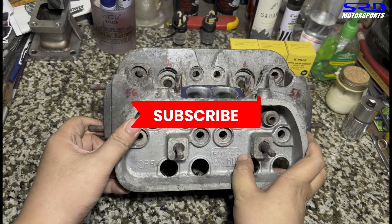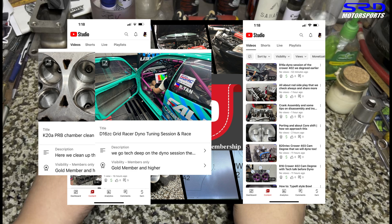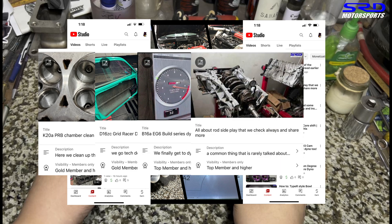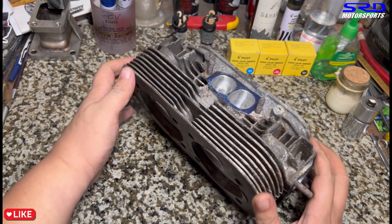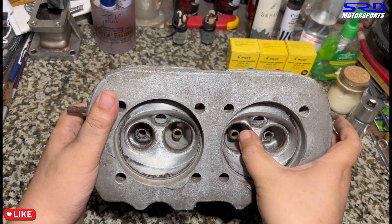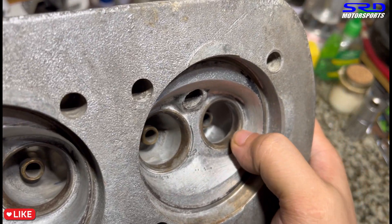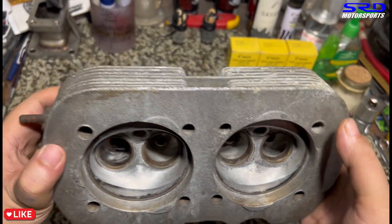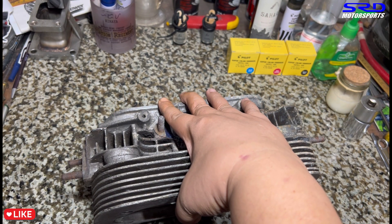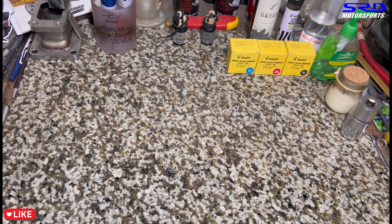For the hardcore, we've got over 19 videos of ultra-technical stuff — valve jobs, dyno, tuning, engine building, tips and tricks, shop tricks — all there for members only. Now, this is a 040 head VW that I've ported, but it's still not machined, nor does it have a valve job. Look closely — it just has a 45-degree seat. That's it. No valve job, no three-angle, nothing. You can't really blame VW; it barely revs over 4,500 RPM in stock form. But when you rebuild it and put a three-angle valve job there, it's such a big difference.